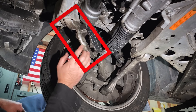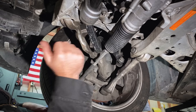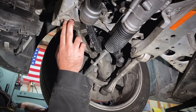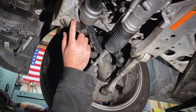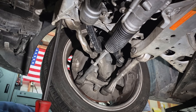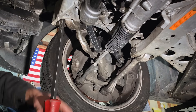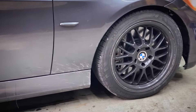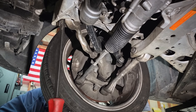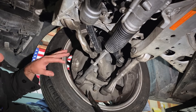Now that we got some room, let me show you how these work. This is your forward control arm and this is your control arm bushing. This is probably the most common suspension failure on any BMW — happens on E36s, E46s, E39s, E60s, E90s, E70s, E53s, every BMW. These blow out really fast, sometimes as soon as 40 to 60k, and some of them are actually fluid filled. I'm going to take a pry bar and whale on this thing, and if you see when I pry on it, this front wheel actually shifts backwards. You can imagine if you stab the brakes and put a bunch of force on the front of this wheel, it's going to cause that bushing to blow out — the wheel is moving like a whole quarter inch towards the rear. This is a very common suspension component failure and I'm going to show you how to replace these bushings and get this whole front end feeling like new again.